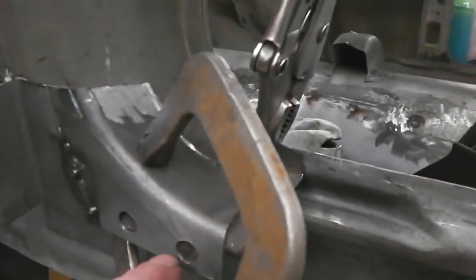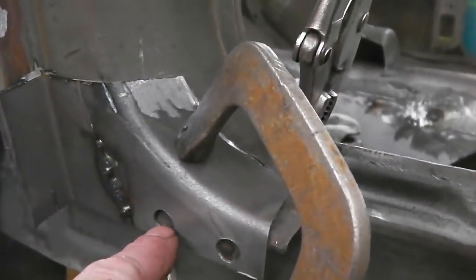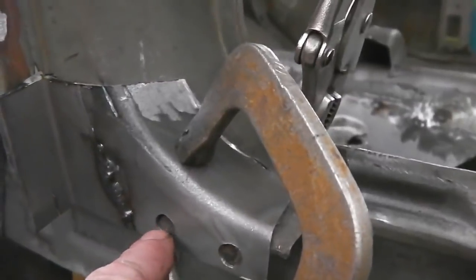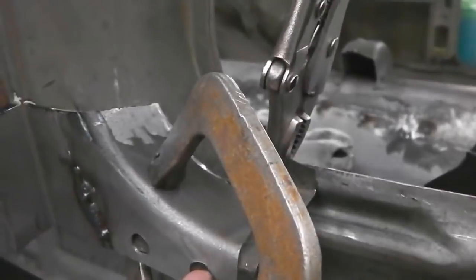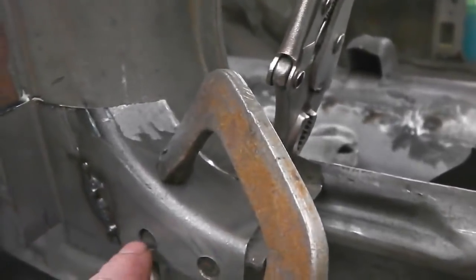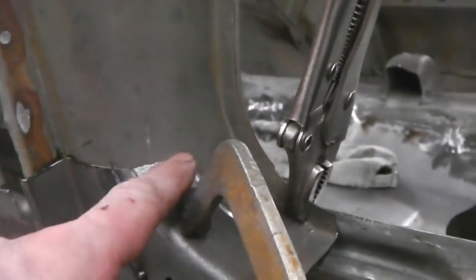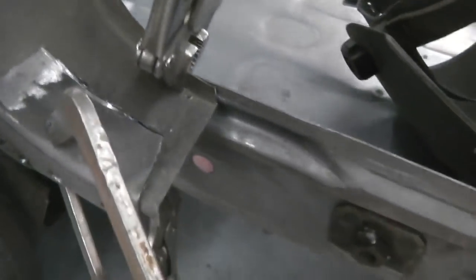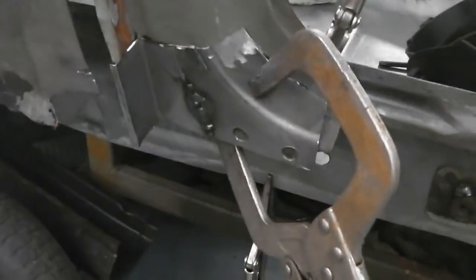Now you're just going to have them half crescents showing a little bit more here, so it won't actually be complete. But we could use that as the plug weld to the sill, because we'd have to drill it to plug it to the sill anyway. So we'll be able to use those existing ones there, the old drill off mark. So the main thing is to get a good cut, then blend that in, do that nose relief section there, and I bet you'll not even know that's gone in.